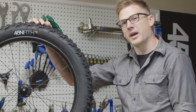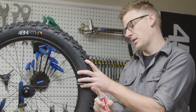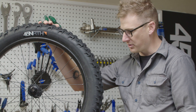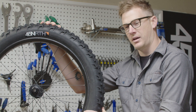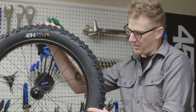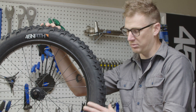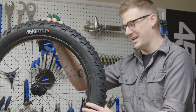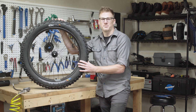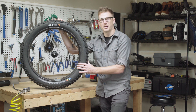There's also a second way of seating the tire and putting the sealant in — using injector devices. A lot of people do this and it's fine. The reason I don't like doing it is that when you put the tire sealant in before you seat the tire, it adds a really good lubrication element to allow the tire to slip up onto that bead at a much lower pressure. I usually see tires go on at 15 to 20 psi. You can risk blowing the tire off the rim, which will permanently damage the tire and could almost permanently damage your hearing while doing so. So I strongly recommend measuring your sealant first, putting it in the tire, being confident you're going to make that seal, going to the compressor, pumping it up — and you're good to go.